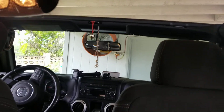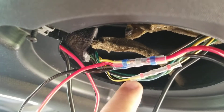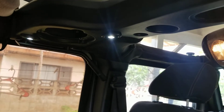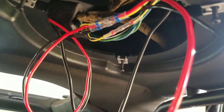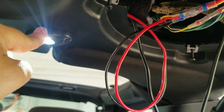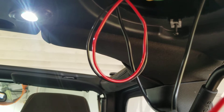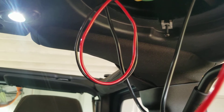If you choose to wire your red power wires into the yellow and black and you install too many LEDs, they blink. I think that's because there's some residual current that overpowers the resistors inside the LEDs, allowing a pulse of power to go through. Once that pulse is dissipated through the capacitor, it pulls a little more juice, charges the capacitor, and discharges — so you end up with a blinking effect.